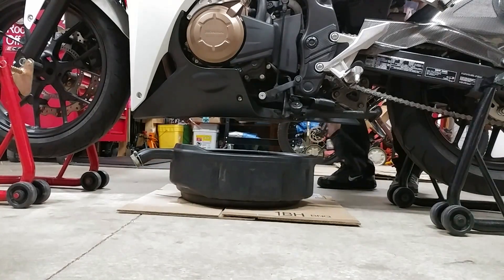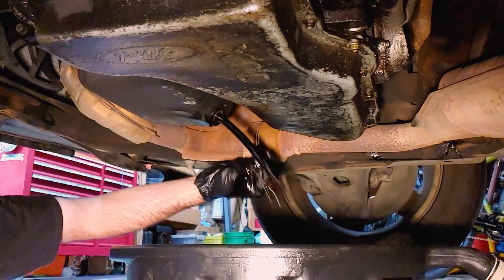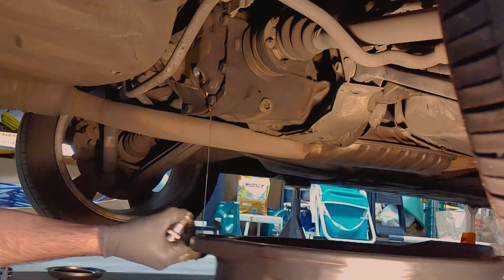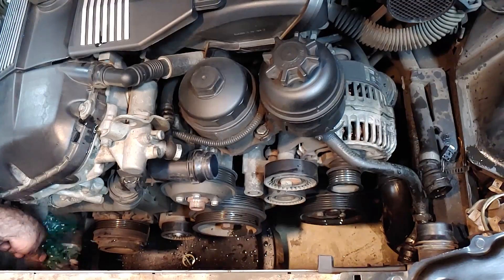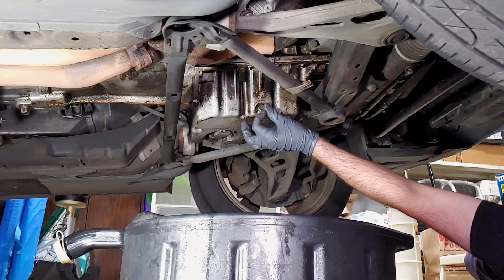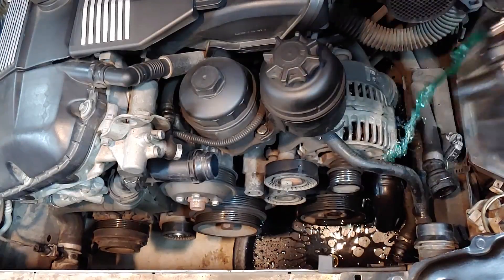On the one hand, I've had this catch pan for at least 10 years and I can't open it up to look inside, but you'd think there would be all kinds of contaminants in there that would ruin the sample. On the other hand, I did empty the catch pan the last time I used it, so now its contents should be at least 99% the oil I just drained from the Jeep, and the lab says contaminants in the oil tend to stay in suspension, which makes me think the contaminants in the catch pan would be less likely to have mixed with the freshly drained oil, but I could be completely wrong about that.